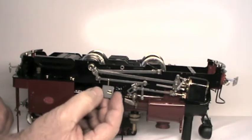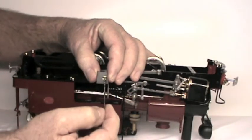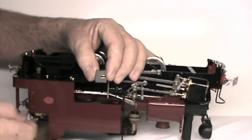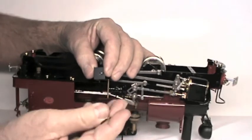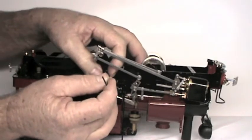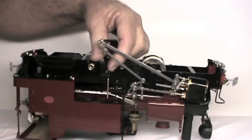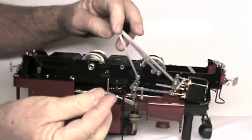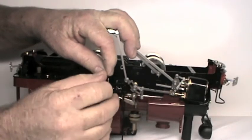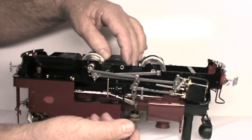The clamp for the back has a slot. When it's fitted the slot must be horizontal, and the slot — which only goes about half the width of the clamp plate — must be towards the front of the loco. Just check that the boss on the back is engaged properly in the slot in the chassis, then do up the bolt. These clamps don't clamp tight to the chassis; they just hold the slow-mo in place, but it will still be free to float between the frames.